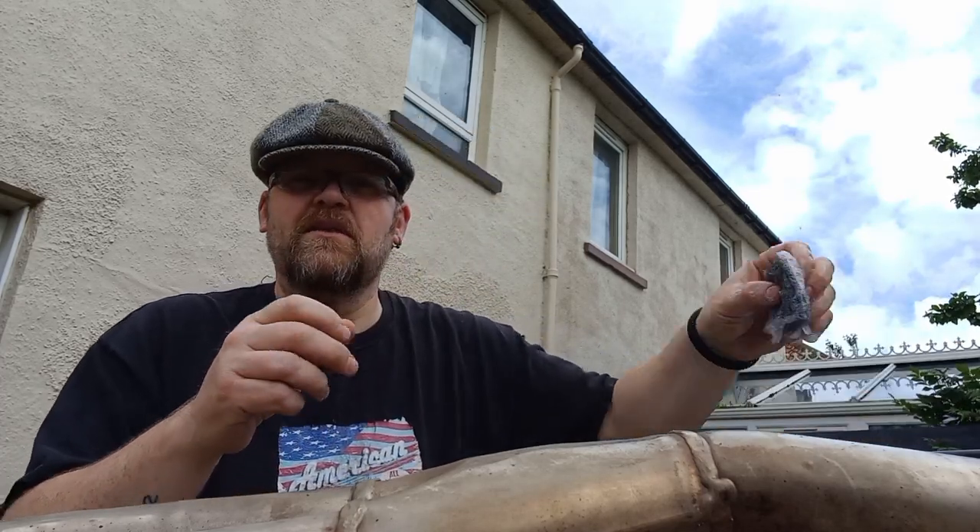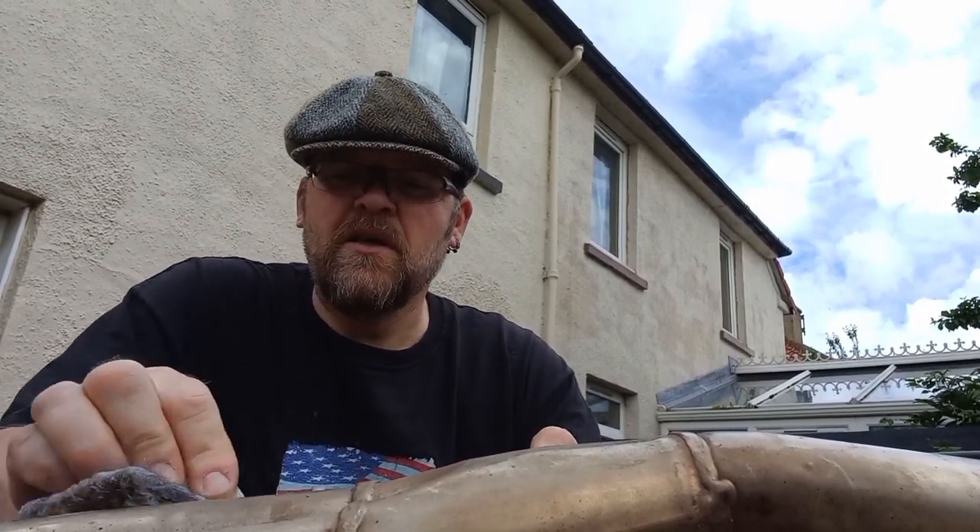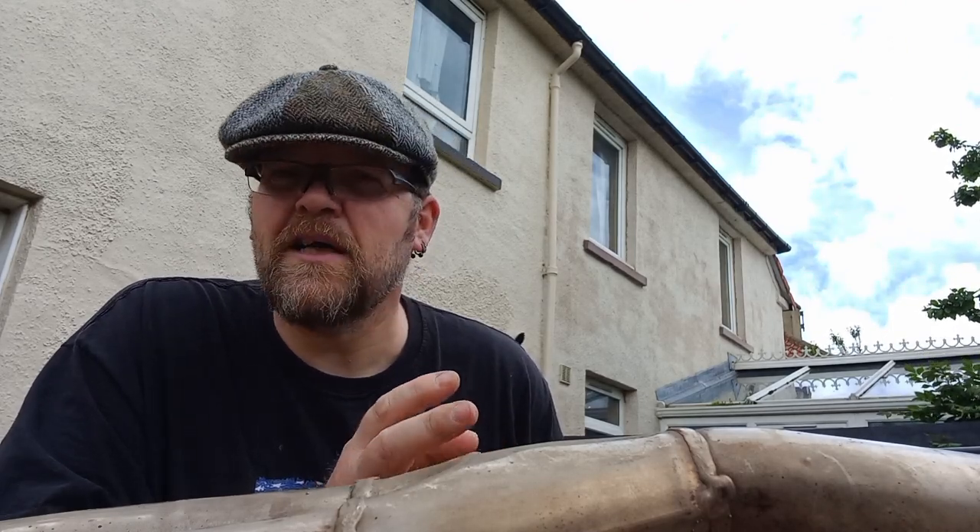Once it's all cleaned using the hot water and one of these Brillo pads, we can get away most of the stuff. And for a final polish, I use this Brasso — that kind of just gives a wee shine. Now you don't want to go over the top with this because it's just sitting underneath the bike, and really the only person that's going to see it is the MOT guy — it's just going to be hidden from view. Which is probably why a lot of these rust away, because people wash their bikes and don't really get into the nitty gritty of the underside of the exhaust. People take care of their cans because you can see them, and sometimes their headers are visible too, unless it's a fully faired bike. But I like to give the whole exhaust system a little bit of attention. It's only really the mild steel that will rot away into holes.